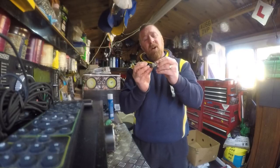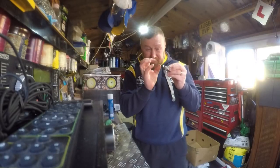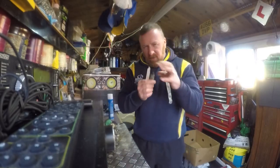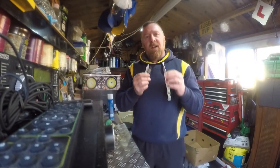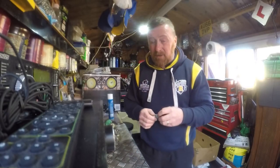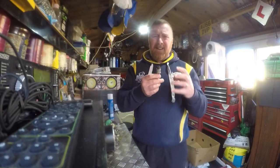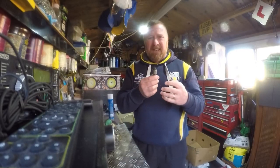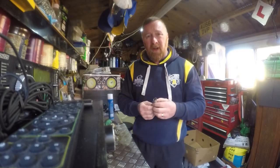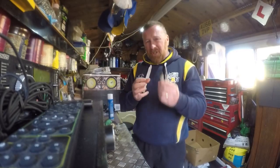When you're testing it with the cap on and turning over, you should get a blue spark - move it away ever so slightly and the spark should jump. If it's a black sooty plug with really thick deposits, you're running too rich and you might be better off just cleaning your air filter. If it's gummed up and I mean really gummed up with sticky shiny oil deposits, you've got other problems - too much oil going in, your rings can be worn.